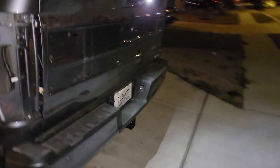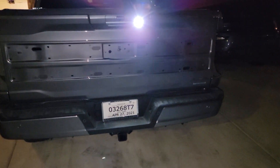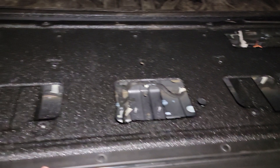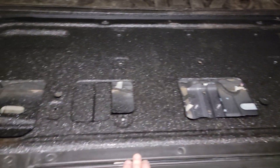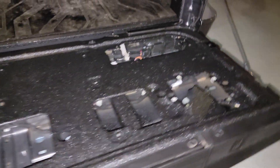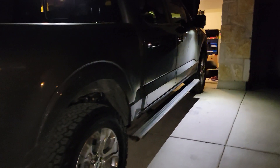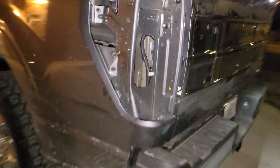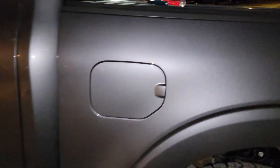Got rid of the handles. I also went ahead and pulled the tail lights out as well as the tailgate applique. I'll show you how I did that tomorrow as well — it got dark so I didn't want to take a video, but to take it off you've got to take the back panel off. This truck had the workbench so we went ahead and pulled the workbench off as well. I've made some good progress in the last 45 minutes or so. Taking the applique off was definitely a chore — you don't want to break tabs, it's kind of inevitable but just take your time.